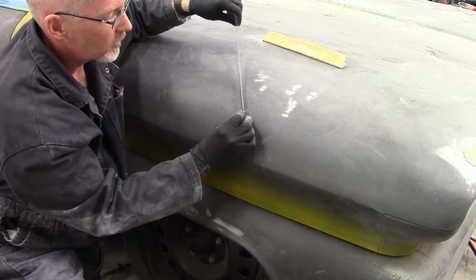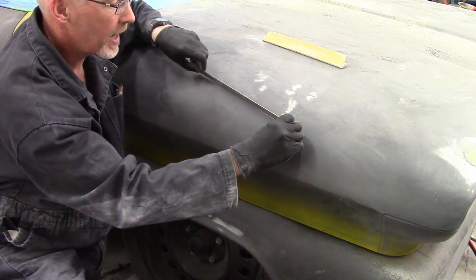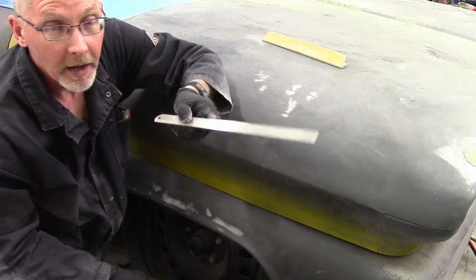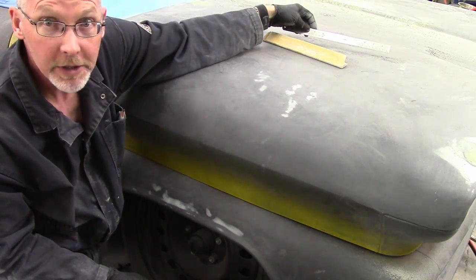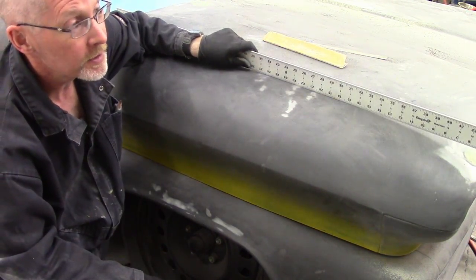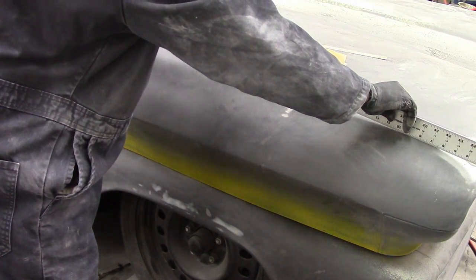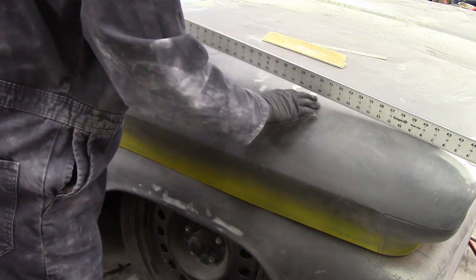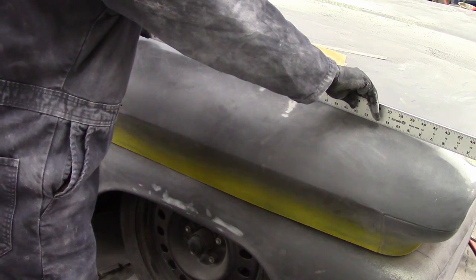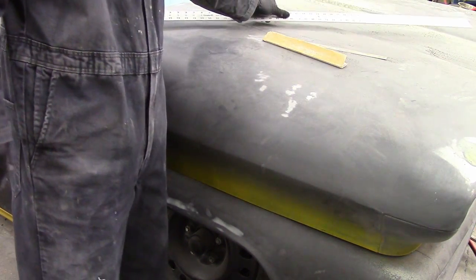This should be able to just go down the curve and not feel any flats. You can kind of rock this back and forth — if it kind of rocks into a spot, you know you've got a flat. This is a 12-inch ruler. I'm pretty sure I have an 18-inch ruler, but I've got big problems. They sell big rulers — this one's 4 feet long, so I can rock this all the way along the hood and see if it moves smoothly. It's actually an issue right here, so I may have to slap that down a bit more. Probably should have done a better body finishing before I get into this, but here I am.